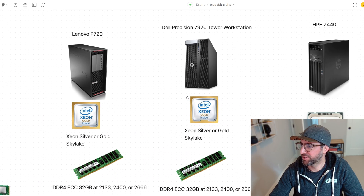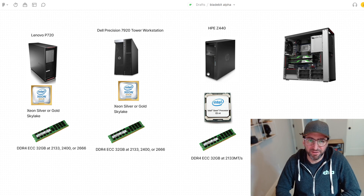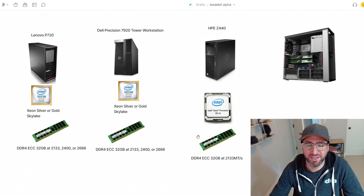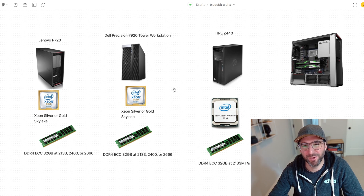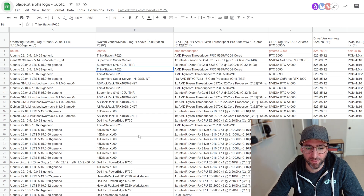The next ones we're going to look at are the PCIe Gen 3 builds. If you want to go older generation — like a Xeon V3, V4 — these are PCIe Gen 3 and DDR4. You can go all the way to V2 and DDR3, but you're not going to be able to resell those whatsoever. An HP Z440 on eBay right now is a hundred dollars bare bones, then a CPU for 25 bucks and 256 gigs of DRAM for $250. All of a sudden you're buying a workstation for around $400, add whatever GPU you have, and you're plotting 40–50 terabytes a day.